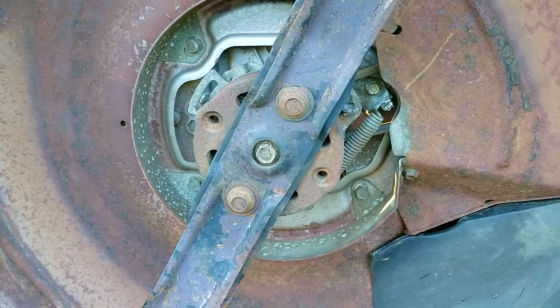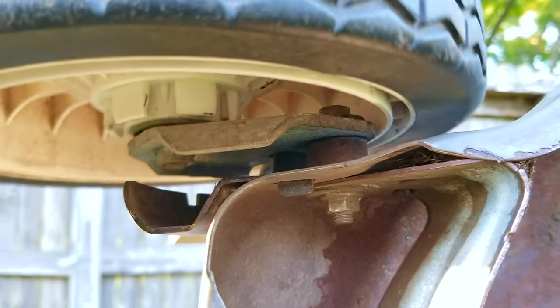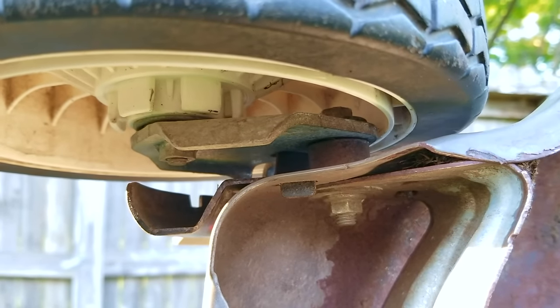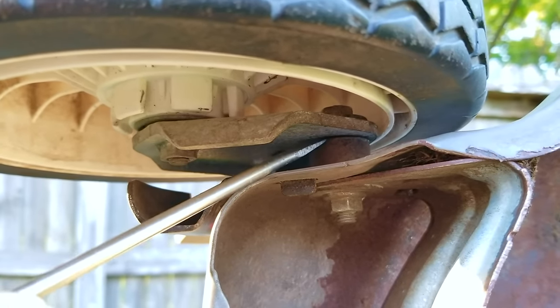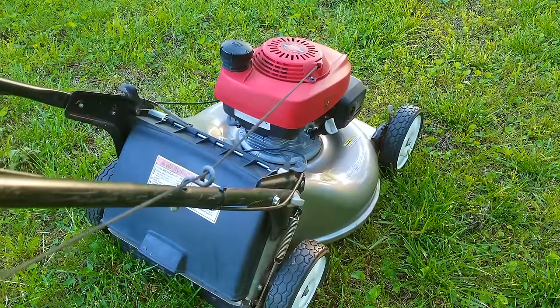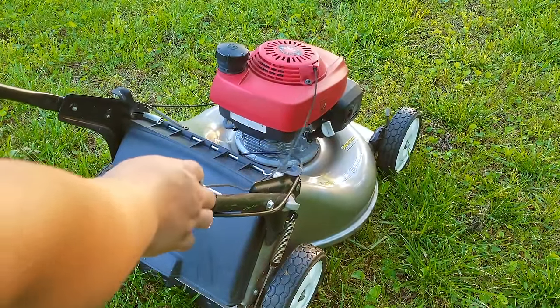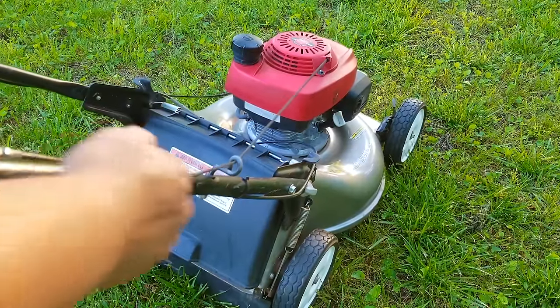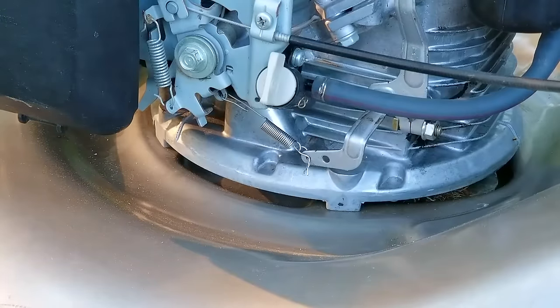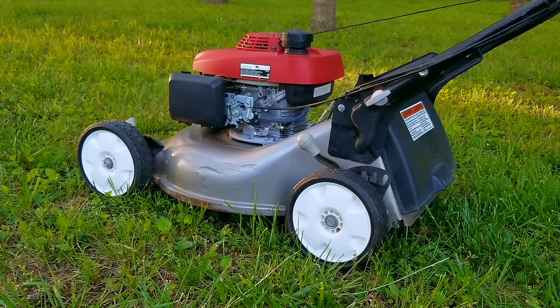That means we fixed the problem and are ready to move on to other issues, like the loose front suspension. This is obviously a wear issue but I'd like to see if we can fix it without buying new front end components. The other issue of course is the pull rope that won't retract smoothly. The most important thing though is replacing that modified governor spring. The only thing I can hope for is that the engine isn't badly damaged from over-revving with extremely low and dirty oil, but we'll have to save that for the next video on this mower.